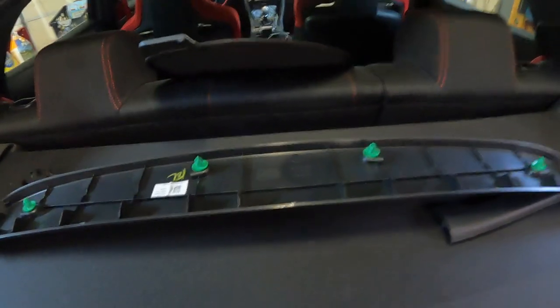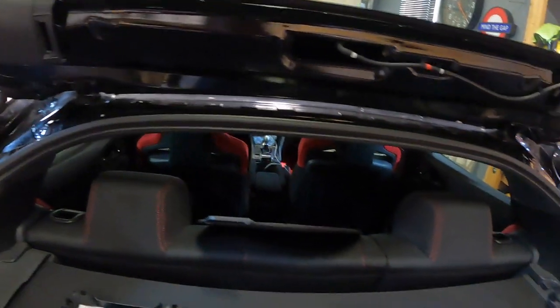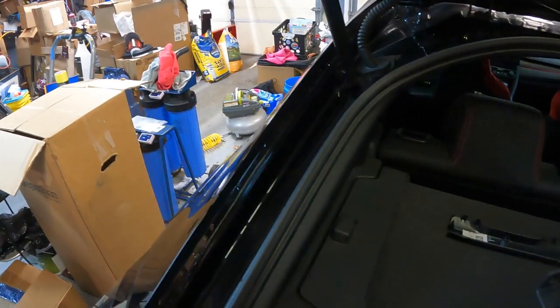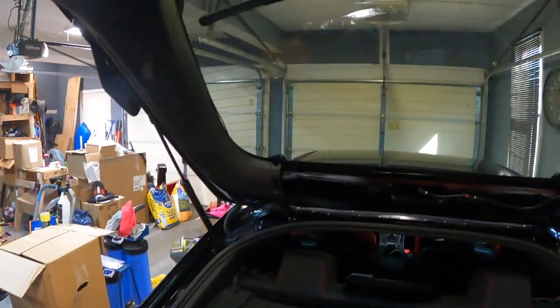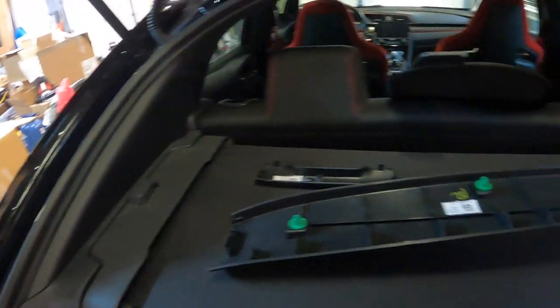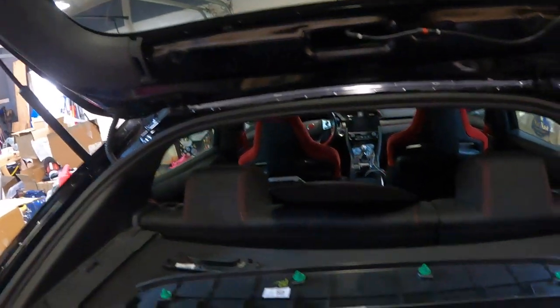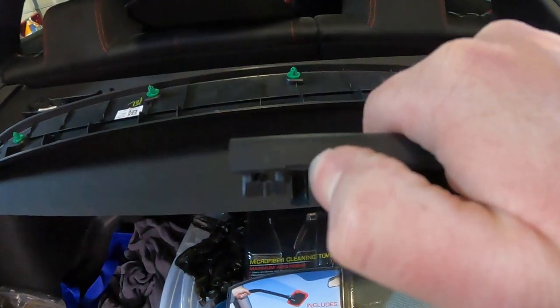So I popped off this cover. I found that if you kind of try to get your fingers in from the glass side and then sort of rotate it down, it'll pop off. You could also try to fish in some plastic trim removal tools like the Harbor Freight ones, but you can just do it by hand — these clips are pretty robust. If you need to replace them they're available. These two covers here just pop off with a screwdriver; if you stick a little thin screwdriver in that slot and pry down, they'll pop off.